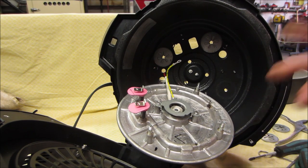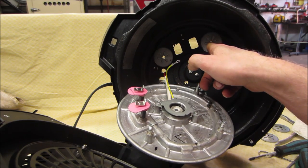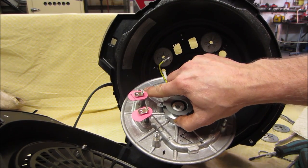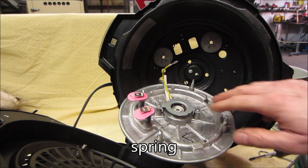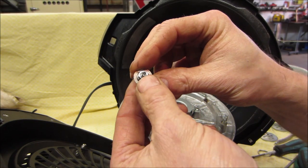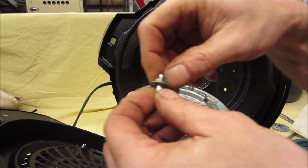When we put this back on, we could probe it again with the meter. I'd figure we should go right to zero ohms across it — so if it's 200 ohms when open and zero when we close, we know it's working. Before it seemed like it stayed the same. I need to get the one leg that pulled out — there's a washer that needs to go on this side of it. Worst case I'll tack it on. That stud looks like it has an Allen wrench head in the center.